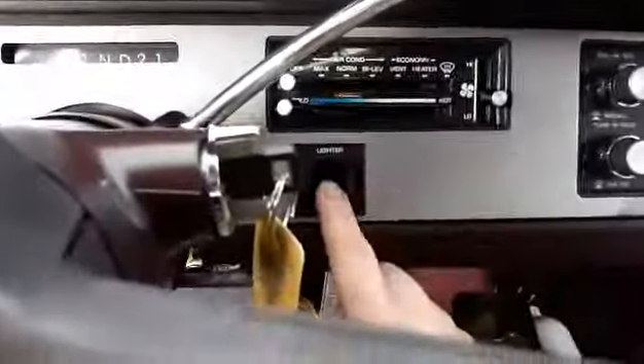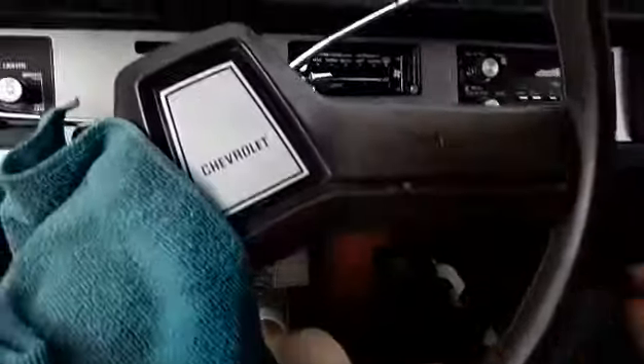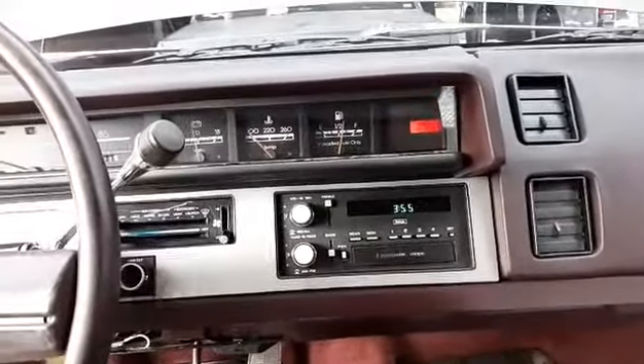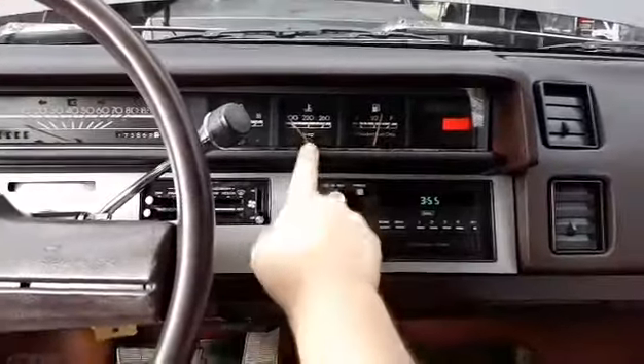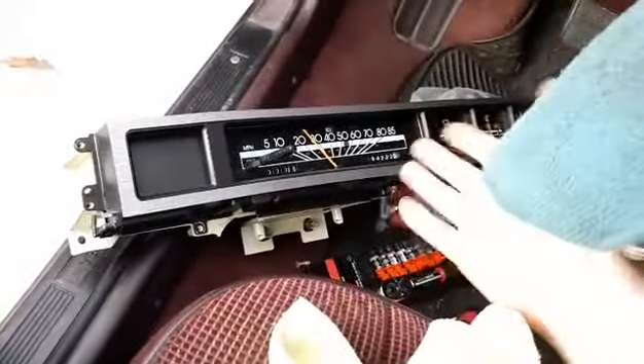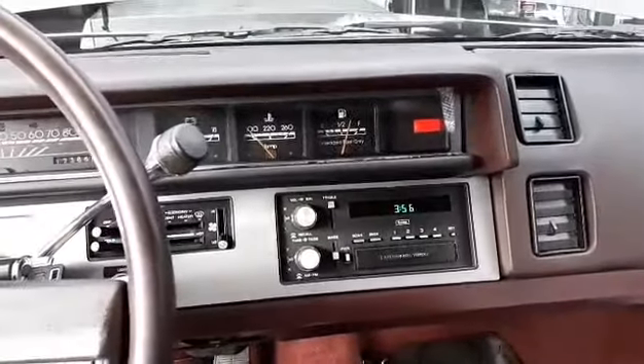Then you plug the main plug that's inside, and the other plug pops right into the back of the cigarette lighter. Once you do that, everything's done — fire it back up and the gauges work. I had a problem with the temperature gauge reading incorrectly, so I picked up a spare from the junkyard and swapped the gauges out, so now the temperature gauge actually reads correctly.